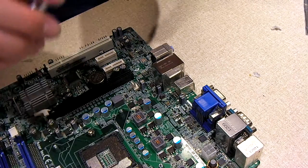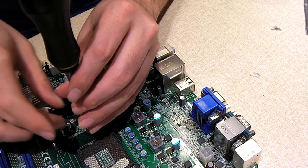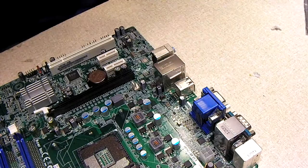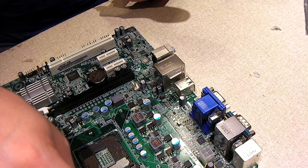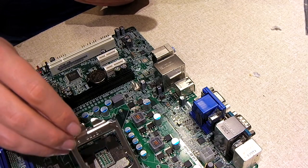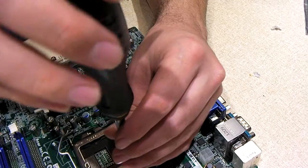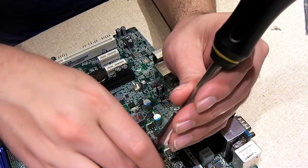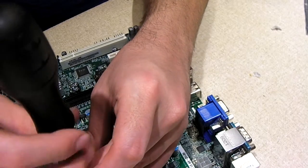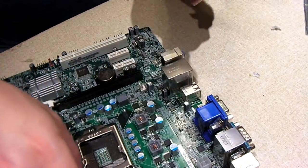That's primarily why I've mostly built with AMD over the years. AMD, for the most part — for example on socket AM4 Ryzen — if I wanted to, I could use a heatsink fan assembly that was compatible with Socket 754. The clip mounts should be able to work. Whereas with Intel's system, forget it. Coolers that mount through the motherboard — AMD has changed things up quite a bit over time in various areas. But if we're just talking about a standard clip-in heatsink fan, the older ones would work just fine with the newer motherboards.